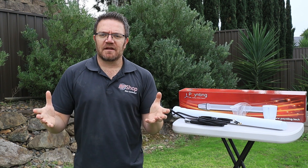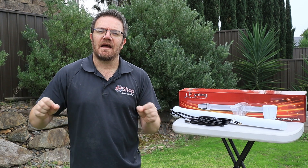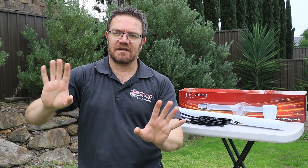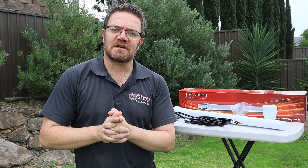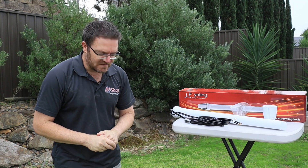What that means is you can't put a two-antenna solution on a four-port 5G modem anymore — at least not the X50, and I think it's the same for all the premium, higher-end ones. You really need to get four antennas out there with signal of some sort. In 4G you could have two out and two on the inside, but in 5G we need to do the right thing for the modem, otherwise you may have a negative experience that leads to all sorts of issues.